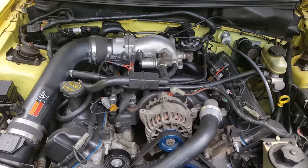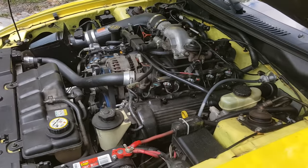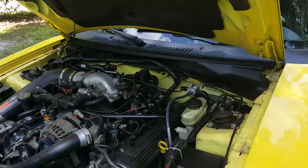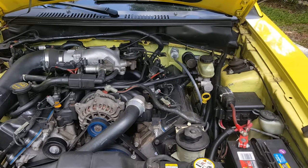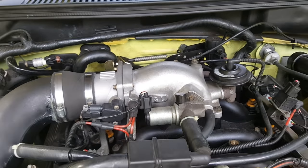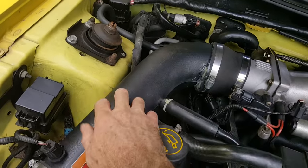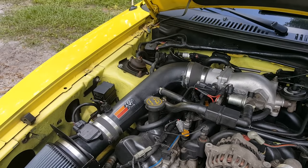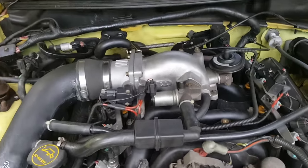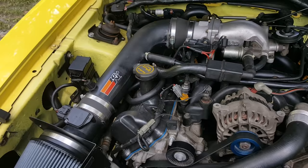Make sure it has the right intake manifold. The second modification I would advise — a lot of people say gears, and gears are definitely an improvement, the stock gearing is rather weak — but I would get a plenum first: a good aftermarket CNC plenum from Professional Products, Accufab, whatever, and a 75mm throttle body. Then get rid of the factory rubber tubing, which is quite restrictive, and get a good cone air filter. That's all relatively cheap — about $100 to $250 on eBay depending on brand.